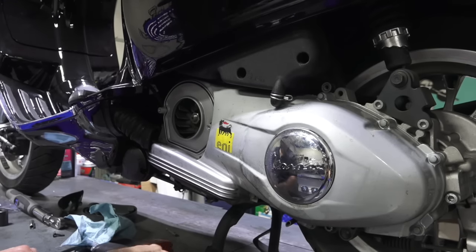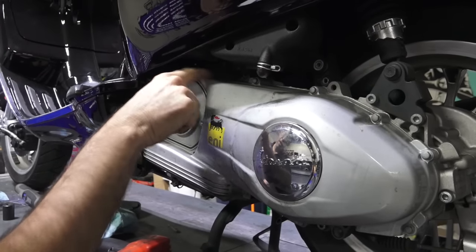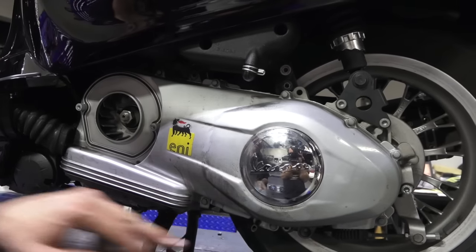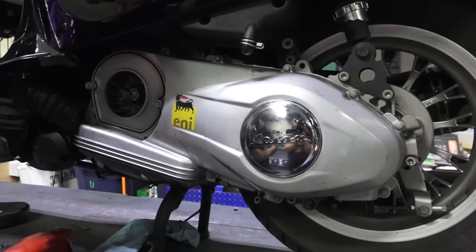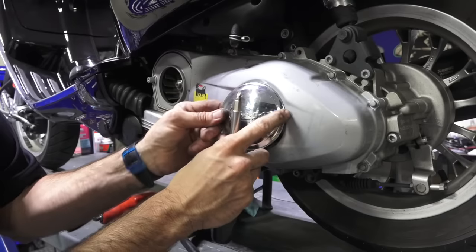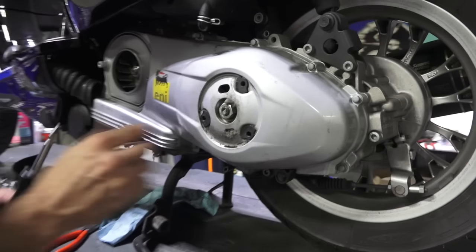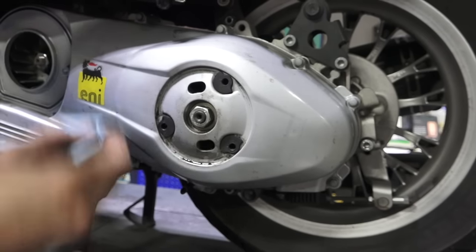Pull that screw out and set it aside. You can push the air box up and now gain access to the upper screws. You'll notice this area is kind of oily — I'm not going to do the oil change right now, but I'll probably drain it when we have the belt cover off, otherwise it'll pour all over the belt cover. You can see a first telltale of the broken belt: there's fuzz coming out of it. The dirty oil is just coming from the air box — when you ride these things pretty much full throttle all the time, oil tends to build up in the air box.